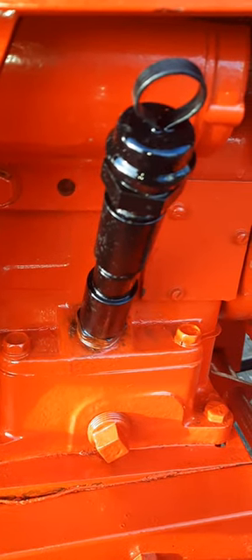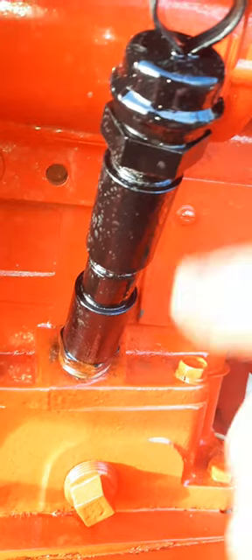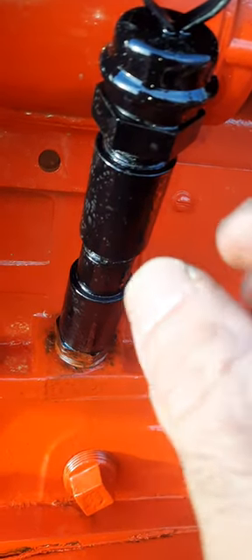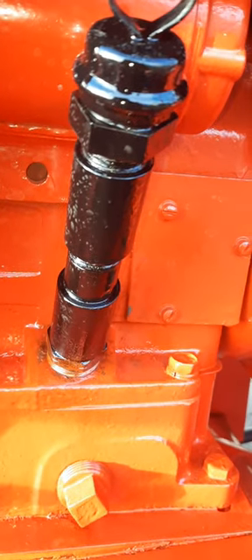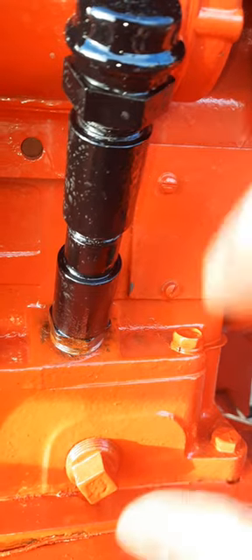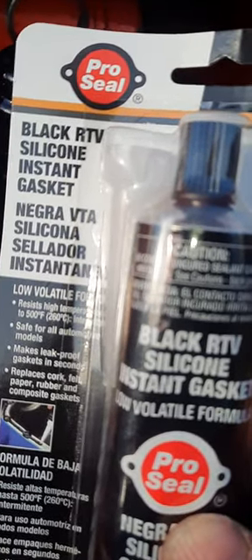So how did I plan this out? I had a three-quarter inch brass fitting — that's the size for the sump. The one I purchased was only half inch, so I had to adapt it out. I found these fittings that don't look like water pipe fittings, nice and smooth, and then I added a nipple in between. I cleaned everything and wire-brushed everything. To find out how it would fit, I filled up the reservoir all the way to the full mark on the original dipstick and played with the length until I got the same reading on the new dipstick. I used RTV silicone to seal everything together.